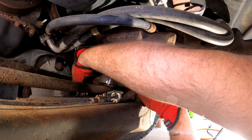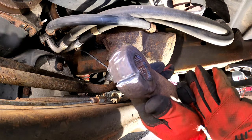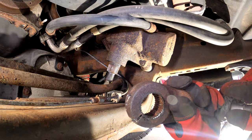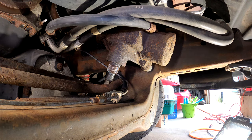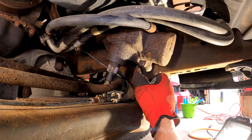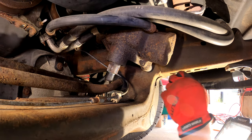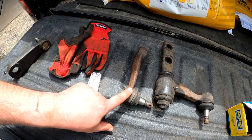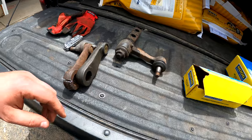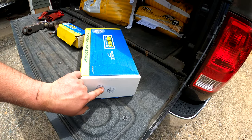Didn't hit the splines or anything. We just notched it and then using the air chisel we widened it and it broke the rust seal. It's got a little bit of play in it — not bad. Did nick the case just a hair, but the splines are all good. So we should be able to put the new pitman arm on. I did mark it on the old arm, so we'll try and match that up the best we can before we put the new one on. We've got the old idler arm and the old pitman arm. Using Moog part number K8700 for the pitman arm and Moog part number K8739T for the idler arm. That's the brand new arm — we'll put the Zerk fitting and everything in, line it back up, and put it back together.